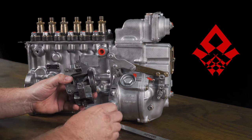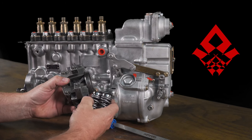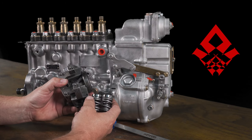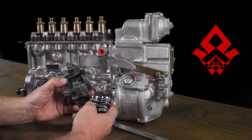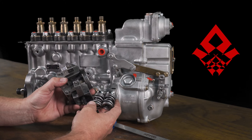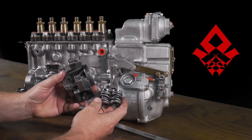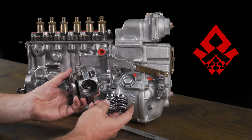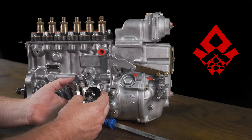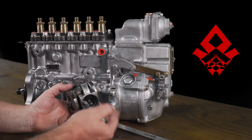We mimicked the factory seat base in our performance springs, and we have more true square-ground springs so that they act just like the premium Bosch ones. There are a lot of Chinese imported governor springs that kind of work, but to be honest, they suck. The truck doesn't idle well, it doesn't have smooth governing characteristics, and the throttle becomes touchy at times. When these get installed, the factory governor springs get removed, and this base goes down to counteract the movement of the weight, letting it govern at a higher RPM — essentially letting the pump fuel at higher RPM.